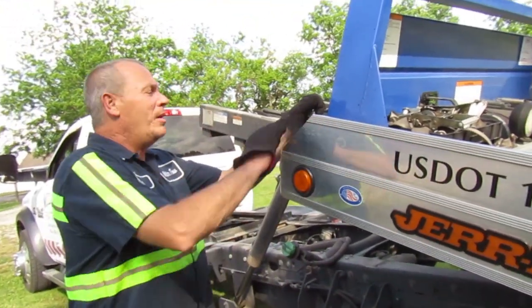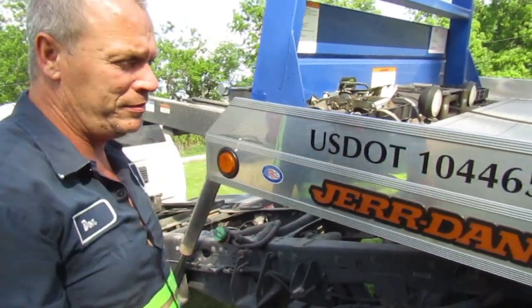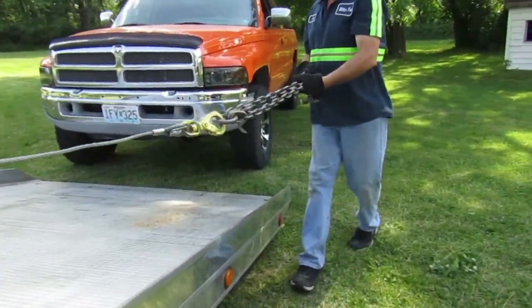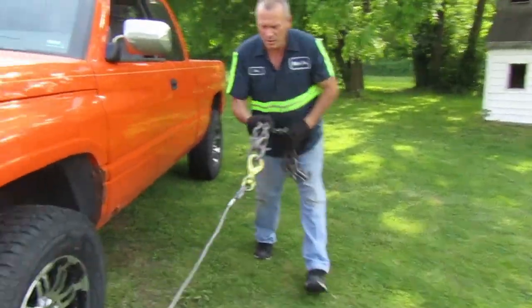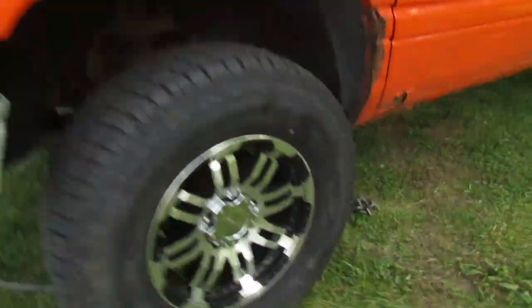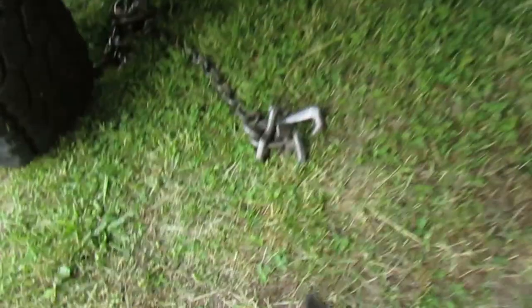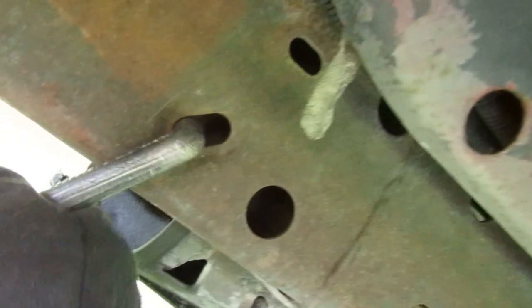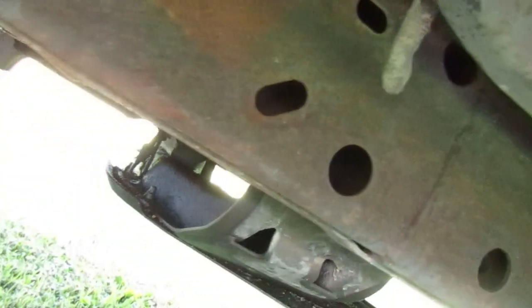I'm going to come up here and release the PTO drum brake — whatever you guys call it, everybody calls it something different. That way I can pull the cable out. Now, on my truck there's a couple different ways I can hook this thing. As you can see, I've got a hook here and a hole here where I can place it, but the problem with that is sometimes when you put the chains in and start pulling on them, the frame itself hits it and pulls the chains out. So we don't want that — we don't want the truck to take off rolling or anybody to get hurt. There's another hole right here; that's where I'm going to stick it.